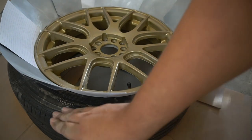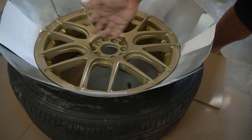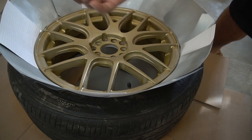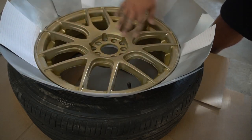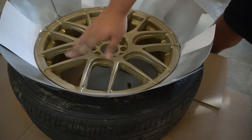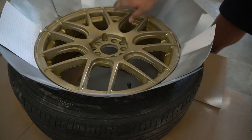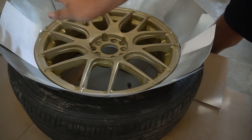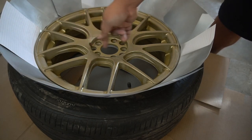Like I said I'm not too worried about getting paint on the tire because I'm going to get new tires on these wheels. Before we go ahead and start painting, we're going to put the primer under some warm water because it's been pretty cold, and after that shake it really well so we don't get any buildup. Don't worry if you get any runs or buildup on the wheel, because since we are using sandable primer we're going to be able to sand it down and smooth it again before we get to the paint. Just try your best to keep it nice and clean, but if not, don't worry — after we prime we're going to sand it again to get the best finish we can.